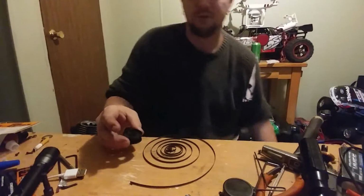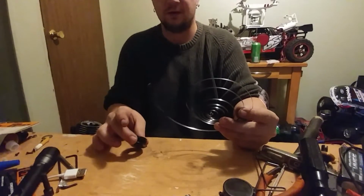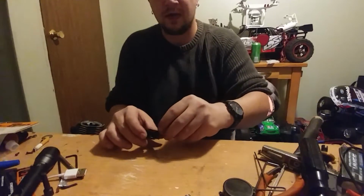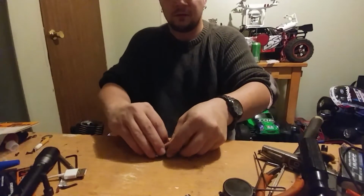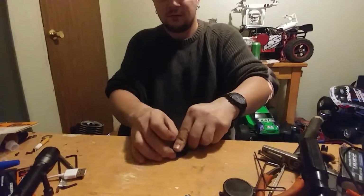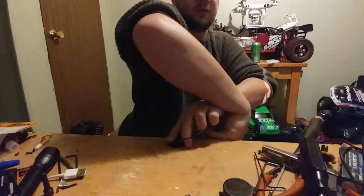But with a pull start, there is going to come a time where you either break a rope or the spring comes out, and I actually learned how to put it back in all by myself, and it's not hard. You'll see you have a little hook right here, and it hooks into this plastic. And now once you get that hook there, all you do is spin. You got to get that in there. Start spinning the black and get the coil spring seated back in. That's all there is to it. Probably be easier with the coil spring up here and not down there.